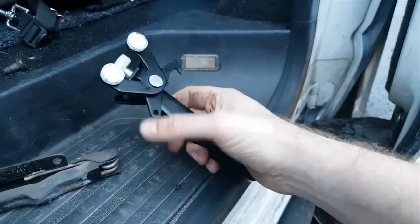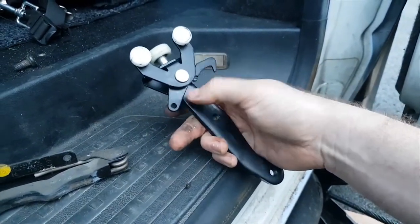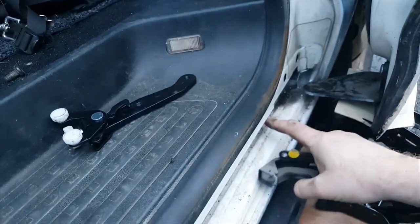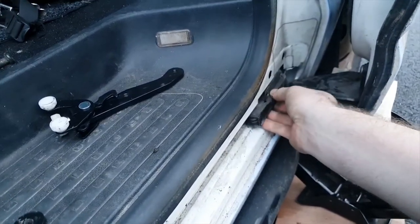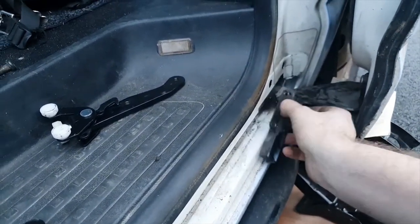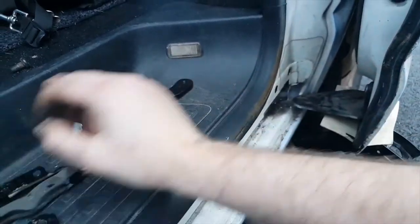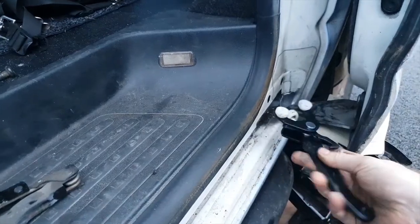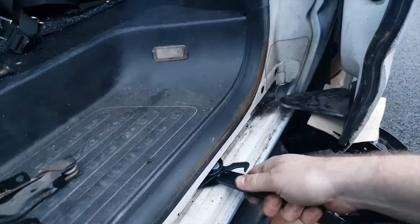If it causes any issues in the future without using that, I will update the video in the description so you can find out. To take it out, once you've undone it and pulled it all the way down here, undo the two bolts that hold this kind of bracket in, this spring-loaded thing that keeps the door open. Pull it out, and then the new one will literally just slide in the gap, and that's done now.